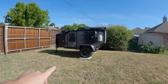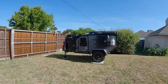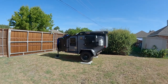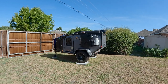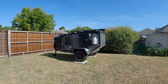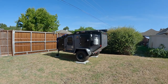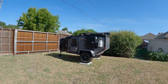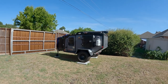What happens — and I didn't notice this until I brought it back from my last trip — is you'll have a slow drip in the back, water dripping off. It has to be on level ground to notice it. When I got back from my last trip I had it parked out front and noticed a small drip coming out of the back end. When you open the valve, water comes out as it should, but when you close it, it doesn't seat all the way and you get a very slow drip. I've submitted a warranty claim and they're shipping me a new shutoff valve. This has nothing to do with the trailer manufacturer — it's their supplier shipping defective parts. It's not widespread, only about five units so far this year.